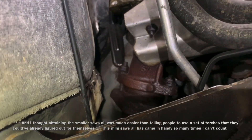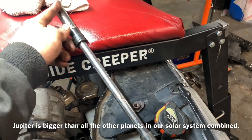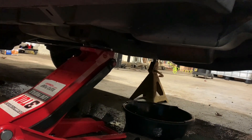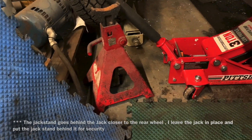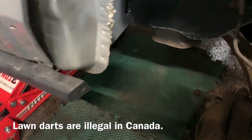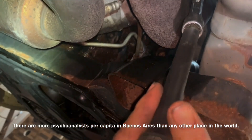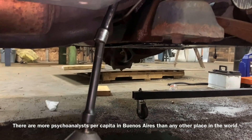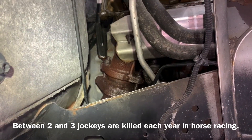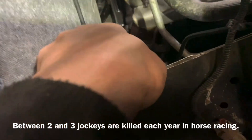The extension I'm using is about 14 to 16 inches long — I have two of them. I'm using my deep well 5/8s and I'm going to try to remove that before actually going to cutting it. I'm going to put my jack on the cross member of the transmission and also use a jack stand for safety. With the jack in that position I'm able to get up and in to them bolts easily. With my extension I come up through there behind the exhaust, in front of this cross member. Because I sprayed this down with penetrant before trying to loosen them, I'm hoping to get at least one out with the impact. Once my tool is up in there, I take my hand around the back side of it to make sure I'm not cutting into something else.